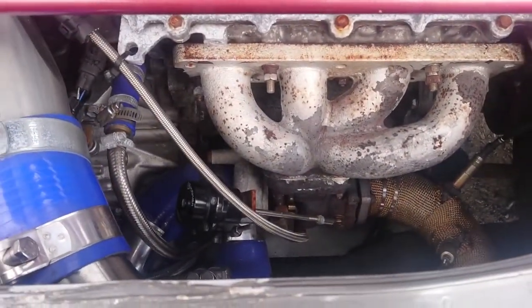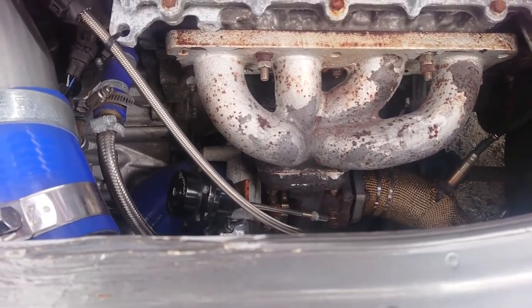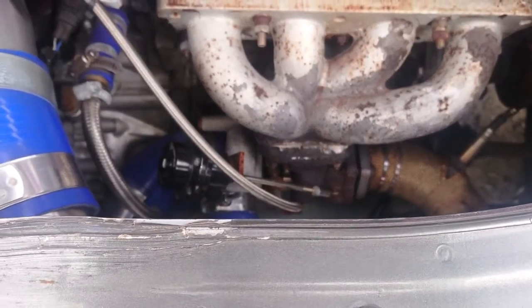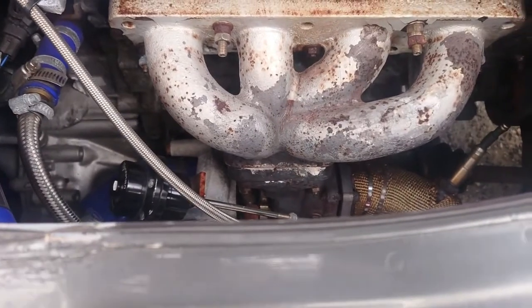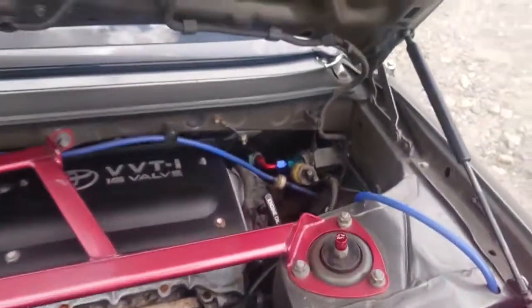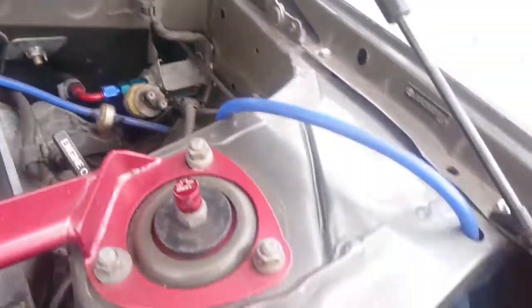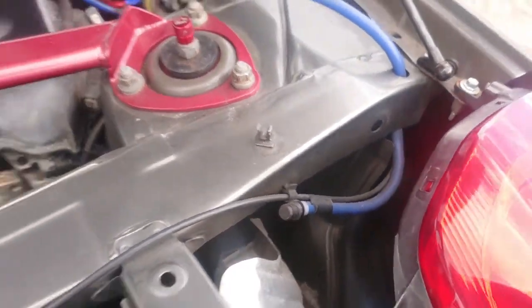The turbo is a TD04 15T. Original destination was a Saab turbo. It's got a T25 gasket, T25 hot side, but my manifold is T3, so you can see there, got a little sandwich block to make that work. Oil cooler tucked away down there. All the breathers removed, and I'm just breathing to a little pit bike filter there. Seems to be doing okay so far.